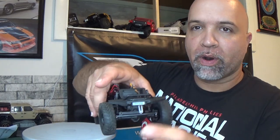I'm putting this Raycent axle back together with the SCX24 axle stubs in to see if this fixes the steering issue. I've got this thing back together again. Let me go over everything I did to the Raycent 1/24 crawler. I switched over the servo to the SCX24 servo. I did end up buying an Emax, but I wasn't going to throw it on here because of how the servo mounts differently on this particular install.